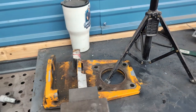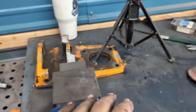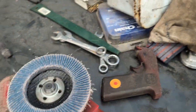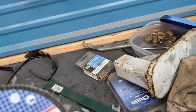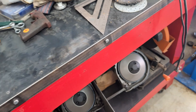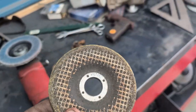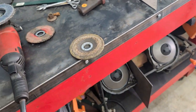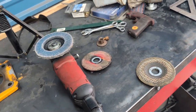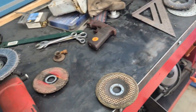When we do these other pieces, I'm going to be there with him. He's got his own YouTube channel and was super nice — I just met the guy, clicked with him in five minutes, and he's all about working with his son too. For polishing that surface up, I used a flapper disc — 60 grit — and it polished it very smooth, gently. I didn't want to use a regular grinding disc; those are about 24-36 grit, too aggressive. I just wanted to polish that surface and get it up in there. Everything's working fantastic.